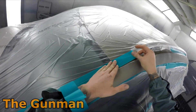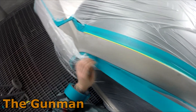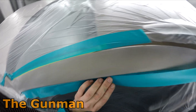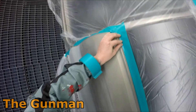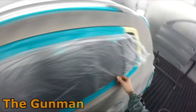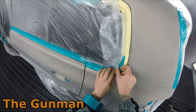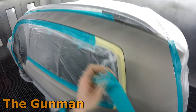On the first job I actually painted in water base, I got a few very slight sanding scratches. The Chromax Pro will be left with a thinner film build than if you paint with most solvent paints. It's literally a heavy coat followed by a drop coat - you hold the gun back - and you are left with a much thinner film build. It dries down very silky, which I'm very impressed with. Just take that little bit extra time with your prep work and maybe change the 800 grit for 1,000 grit.